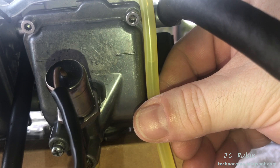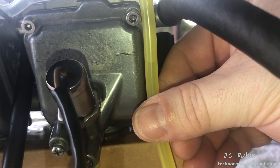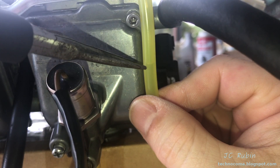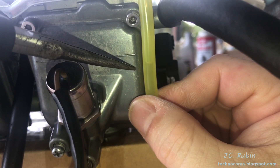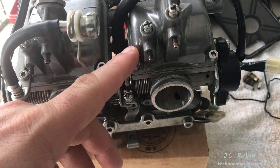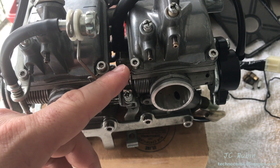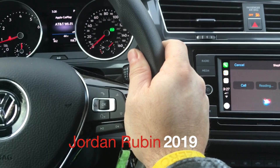I close off this carb and bring the hose to the same height, then pop it right onto the second carb. Open the screw, purge any air from the hose, then do the measurement again — sliding the hose up and down confirms fuel is freely flowing from within the bowl to the hose. Bringing it up to my test line, I find this one to be again exactly a millimeter above the top line. Both bowls have the exact same measurement. For where I want it — slightly on the high side so the bike doesn't run lean — this is a perfect setup as I have this bike tuned and I personally would not be making any adjustments. Having finished testing, part two will address the bowl seals, float height adjustment, float needle, throttle position sensor, heaters, and solenoids — please click the link to go to part two.